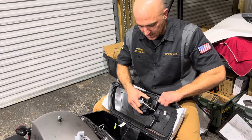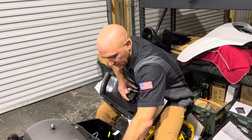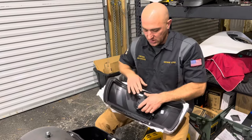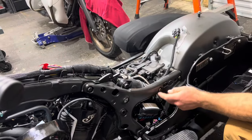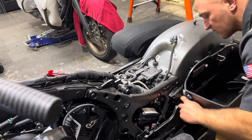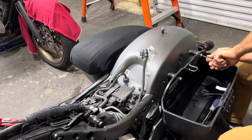And then this is just gonna slide right on down and out past the hinge. And those bolts I will just put back inside the bag, because we're gonna take this and go put it on the workbench. Before removing the saddlebag, you got an electrical connector here, which is on the underside of this side cover. You just take it off, make sure you pull it out of this little retention spot here by your shock adjustment, and then it's 2 6-millimeters that will take the bag off.